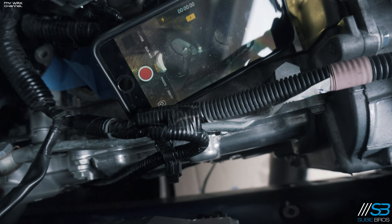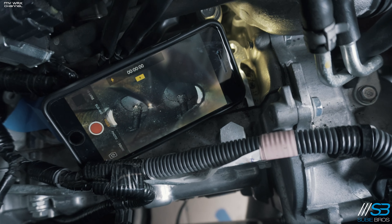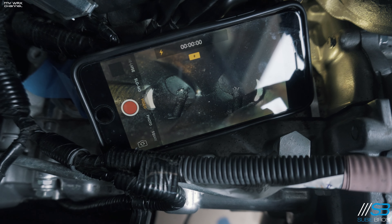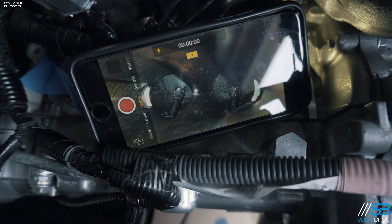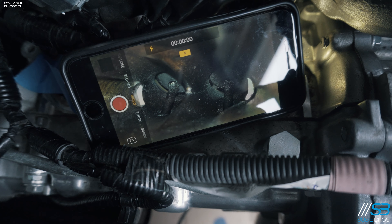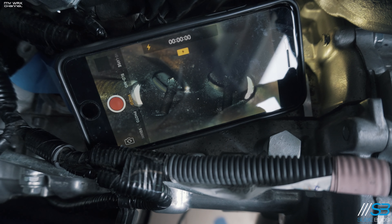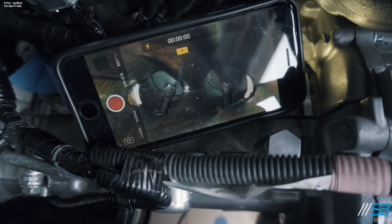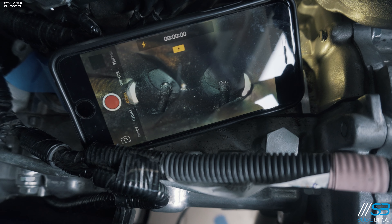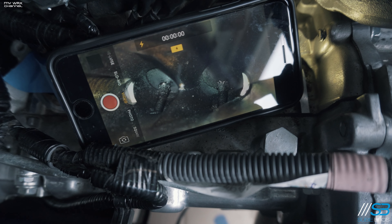You can see here the valves were already open when we started. We'll do a full rotation so you can see what it looks like. Those valves are dirty! Now you can see them open — you can see the color difference with the bare metal. We perceive these as closed now, so we're going to do an additional half turn of the crank just to be sure, and it's closed.